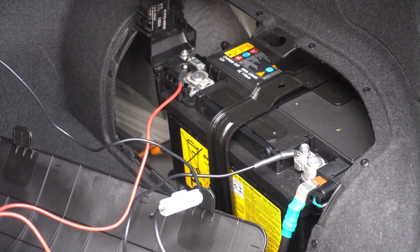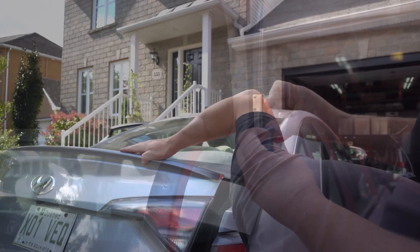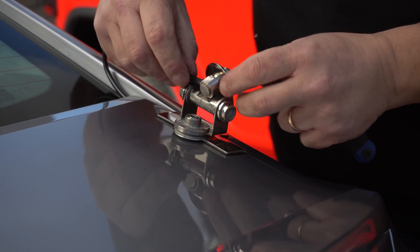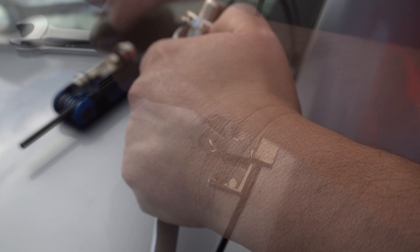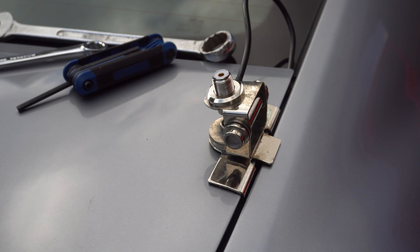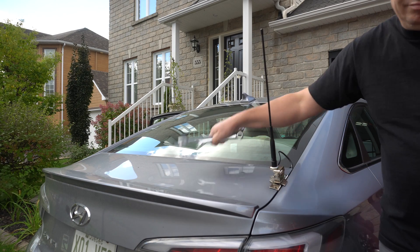I waited for the paint to dry, then reassembled. I also installed the power wire directly to the battery using heat shrink to protect it so there will be no short circuit. You can see the radio turns on, so the installation is working. I installed the bracket to the correct spot and everything went well. I then installed the coax — as you can see there's a groove here, so it goes in this way. The only issue is the coax connector is facing outward, so if it's raining, water could get in. There's already shrink on the coax, but I wanted extra protection, so I applied electrical liquid tape and then installed the antenna. You need to adjust the bracket so the antenna sits straight.